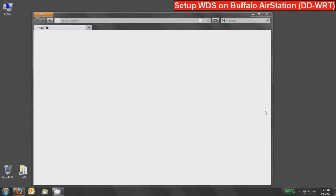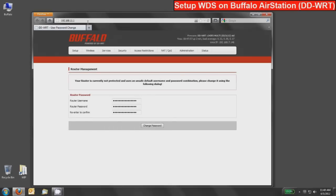We will start configuring the router device first, or the primary device. If you already have your cable or DSL modem or internet connection supplied, you can plug that into the WAN connection port, and then using your Mac or PC plug its Ethernet port into one of the switch side ports for that wireless router. You'll want to access the wireless router's admin UI — go to any browser and type in its IP address. The default IP address is 192.168.11.1.